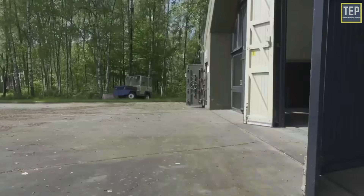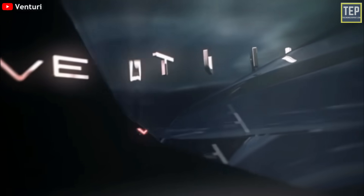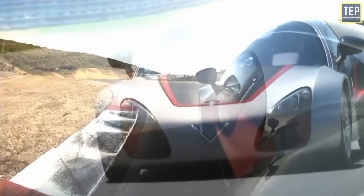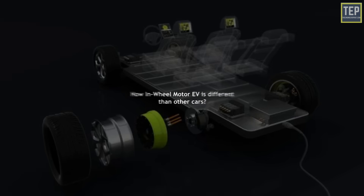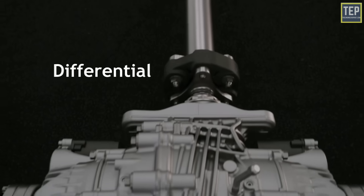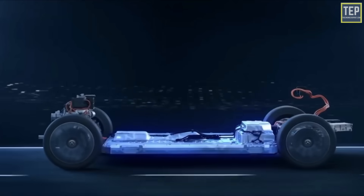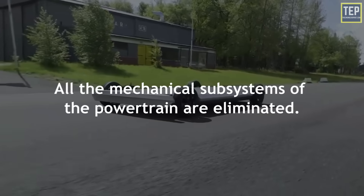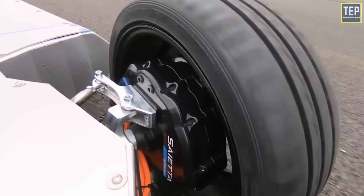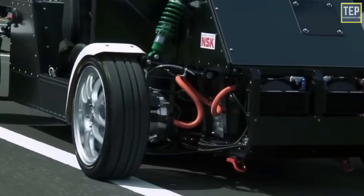Eliminating the engine makes it possible to add design and structural enhancements to a vehicle. Testing of the in-wheel electric motor system has been conducted by many automakers and technology companies, including the Venturi Corporation of Monaco for its Volage concept vehicle, though questions of reliability, durability, and safety are difficult to assess without widespread usage. For a traditional IC engine vehicle, the drivetrain consists of the engine, transmission, exhaust system, drive shaft, and differential. In a conventional EV, the engine is replaced by an electric motor with inverter and batteries. In EVs that use in-wheel motors, all mechanical powertrain subsystems are eliminated, with only the conventional suspension remaining.